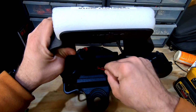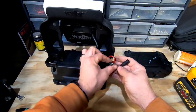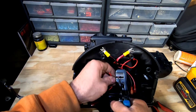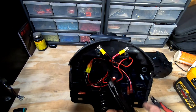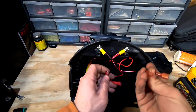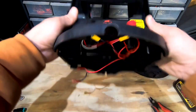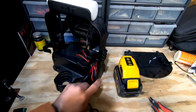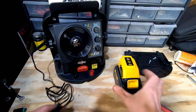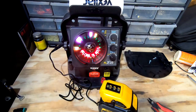You just feed the plug through the hole, routing it right next to where your charger plug is — it's on a couple of spade connectors on the end. Once you have your spade connectors installed it's literally plug and play, negative to negative, positive to positive. On the backside of the unit we have our jack that we just installed — go ahead and plug that in, come around to the front jack on the side, plug that in, and the unit powers right up.